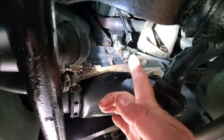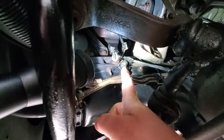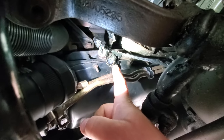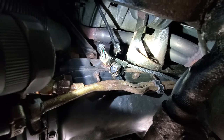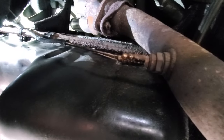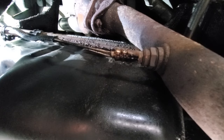Here's a much better look. There's the connector. We're over here by the transmission lines — again, we're on the driver's side of the vehicle. There is the lower rad hose. Our O2 sensor has been unplugged, that's why we got the check engine light and that's why it has been driving a little better. Now this default mode we're driving in ain't perfect — it's better to get information from the sensors to the computer to adjust in real time the optimal condition your vehicle should be driving in.